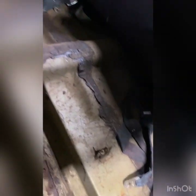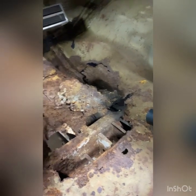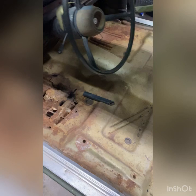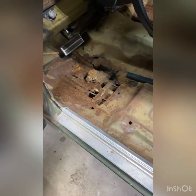The floor pans aren't that bad. Got some surface rust back there. Just like most Mopars, the wiper bushings are probably leaking — that's normally what causes all this rust. The water runs down the firewall and just sits right here from those bushings being bad. Easton's getting the carpet — the floor pan swept out. We're going to probably start cutting the front floor pan out on this side. I'm going to put rust converter down in the cross member, got it vacuumed out, do the same on the frame rail. Then we're going to drill some spot welds because the floor pan is spot welded.